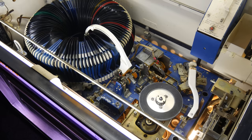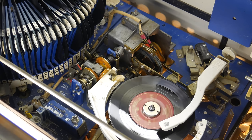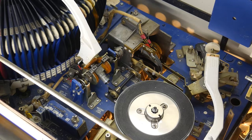With these pulses, the motor is turning just a little bit. We can actually see the cam move slightly, but until it moves enough to let go of the play switch, it's not quite on its way. However, eventually it gets there, the play switch is let go, and now the transfer switch is able to keep the Wurlitzer mechanism turning again.